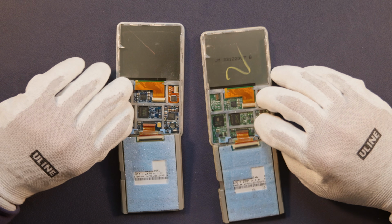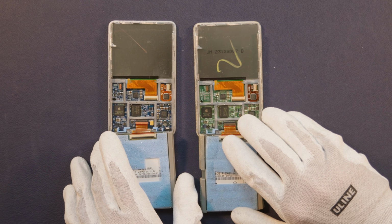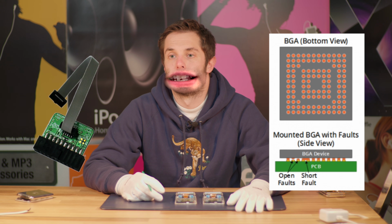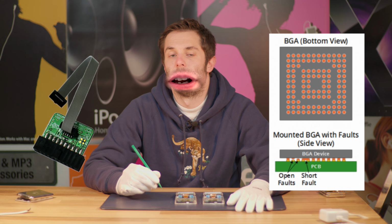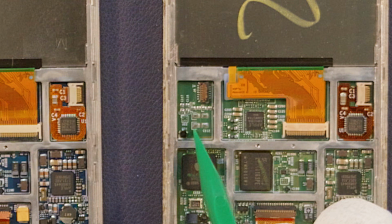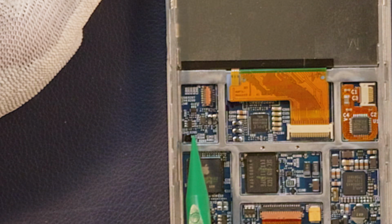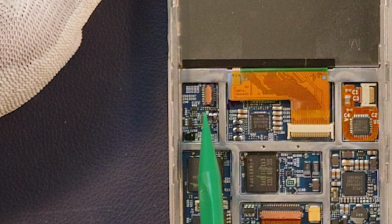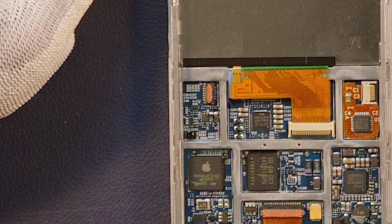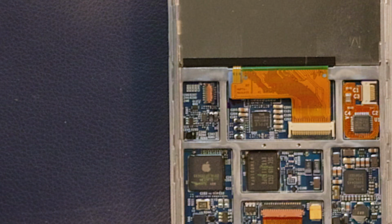And we're just gonna look really carefully for some differences aside from the obvious. Yeah, so it appears that we actually do still have our JTAG hardware on the EVT. The JTAG being the Joint Test Action Group, an industry standard for verifying designs of and testing printed circuit boards after manufacture. On this production board, you can see the JTAG sector here is void of any components, but on the prototype here, we do have all of our JTAG components.